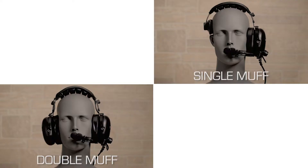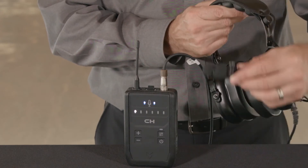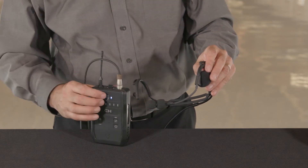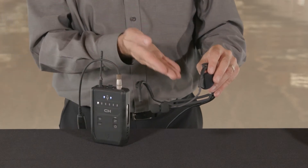The next step is to make sure that the mic is active on the unit. With units that have an articulated boom arm, lower the boom arm until you see a blue light illuminate on either side of the mic symbol on the intercom unit. On units that do not have an articulated boom, there will either be a switch or just use the button right on the mic symbol in order to activate the mic. When you see blue lights, that means you have a talk slot in the group, and your mic is active.